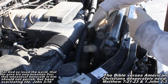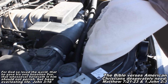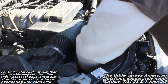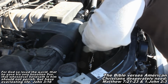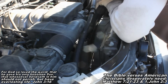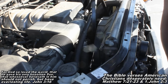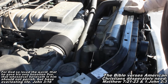Okay guys, so now I've got my ratchet on the end of that fastener. I'm just going to push this way. I'm going to reach down here, and on that big pulley to the left, I'm just going to pull the belt off. Then my ratchet will go all the way that way, and then I'll be able to remove my belt here. Since we have that chart, we don't really need to remember the way it was stuck on there, but it's kind of helpful to remember the way you took it off. Kind of makes it a little easier when you're going to put things back on there. And really, you can just pull it out of the way about right there, because our alternator is sitting right down there and our belt is no longer on our alternator. So I'll just kind of let it fall down there.